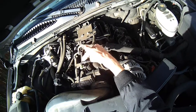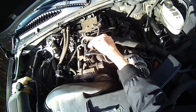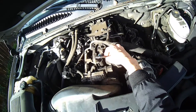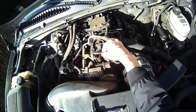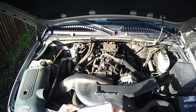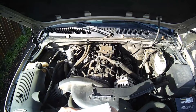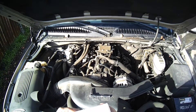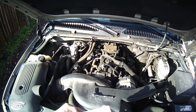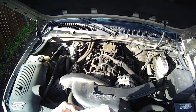It's a solenoid — when it opens up it's going to let some of those vapors go in and burn in your combustion, which is great. But if it's malfunctioning it may not be opening, and that vapor is just going to keep building up and you're going to get that symptom. We got a replacement online — part number 214-6460199727 — and I will get you a link for this in the description below.